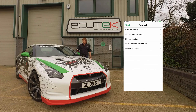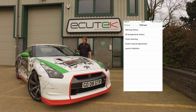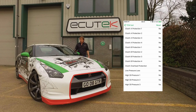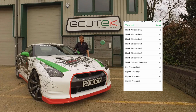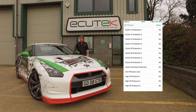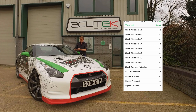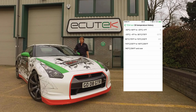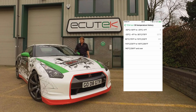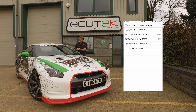Transmission tools — the GTR has a very trick dual-clutch gearbox, and we can use the TCM tools to do various things with it. The top item is warning history — the gearbox records many parameters. In this example we haven't got any thresholds tripped; clutch protection and high pressure oil loss are all set to No because the car doesn't have any problems. If clutch protection flags have been tripped, you can reset them using ECU Connect. Oil temperature history shows the frequency at which certain temperatures have been reached in the gearbox oil — most of the temperature history has been between minus 20 and 80 degrees C, with a few events over 80 degrees up to 110.